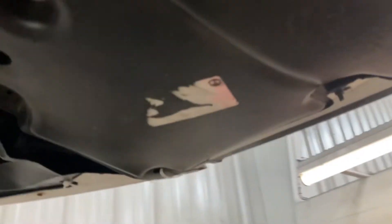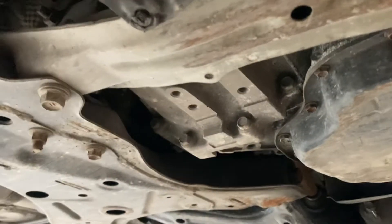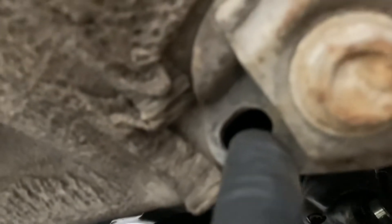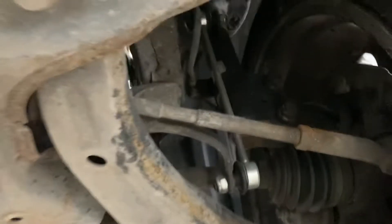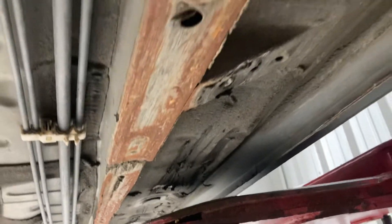Wonder how far back this car was hit. The cross member is kinked. You can always tell — there are alignment holes here. It's pushed back in the hole and it's now touching right here. This one's still got the rubber plug in there, it didn't fly out. It's not making contact there. And it's dragged along the ground for a while.